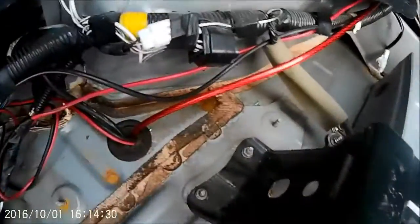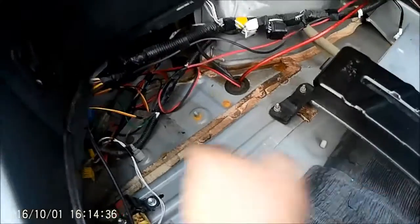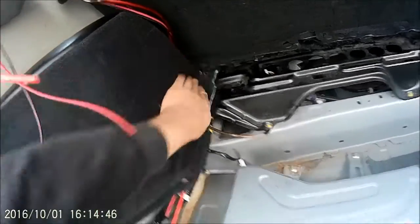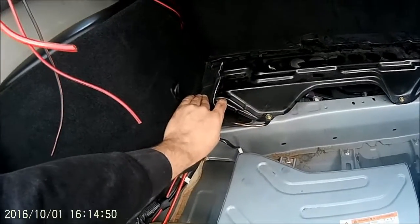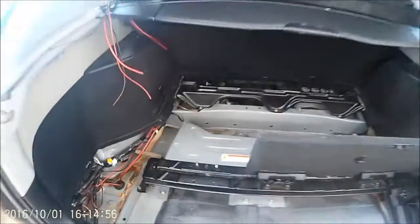This gives you access to wire some wiring for your subs or a towbar bypass, which I've put in today as well. All I've done is wired my cables up through this panel, drilled a hole through the back so you can't see them, and I'll be putting my high-to-low converter on and then connecting it to my sub. Thanks for watching - any questions, just ask.